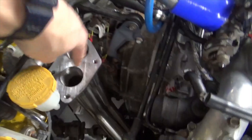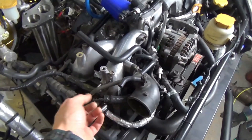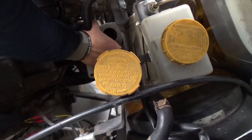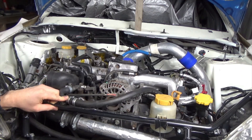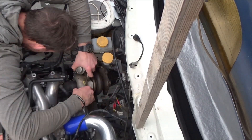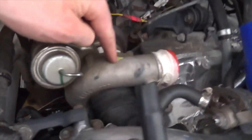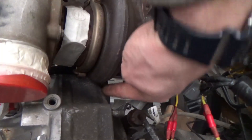I have just figured out the uppipe will not fit between the engine and the subframe. I think the easiest thing to do is to take the dog bone mount off the gearbox and lift this side of the engine up enough to get the pipe down and through. I don't have the engine crane anymore so this had to do. I've just loosened the bolts for the main subframe — and now we're through. You can see the housing is basically touching the gearbox there.